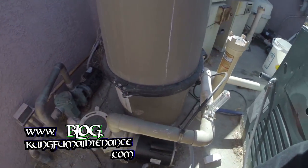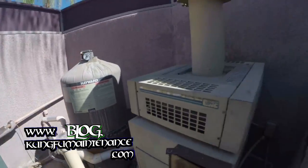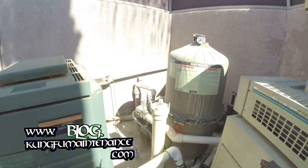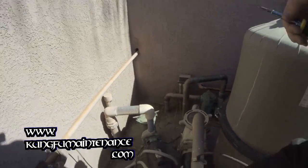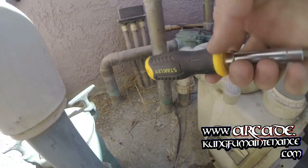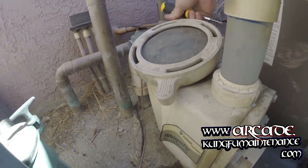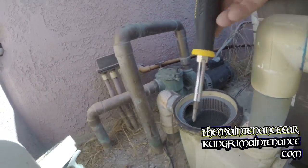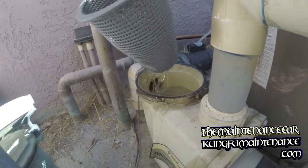One new capacitor. Putting the back cover on — it would be safer to turn the power off. That'll also give me a chance to clean out the filter basket. My Billy Club screwdriver works really good for opening those up. It's definitely one of my favorite tools.